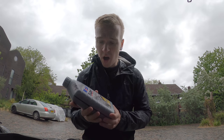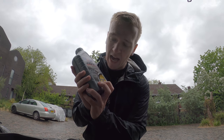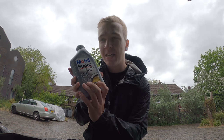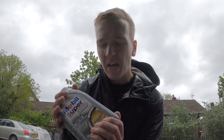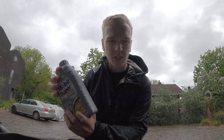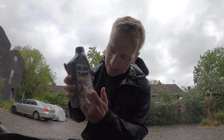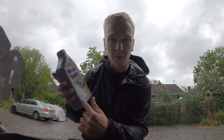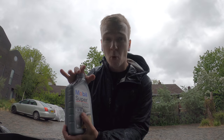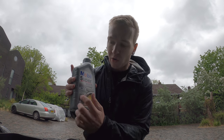This is a 0-20 grade oil. What's important for the LEVC cabs is that it has to be a Volvo spec oil. There'll be certain additives in here — a lot of it is kind of sales mumbo-jumbo, but it's supposedly a clean burn and will have certain additives specific to this engine. Branding really doesn't matter as long as it meets that specification — most of these are all fully synthetic now.